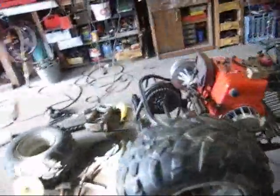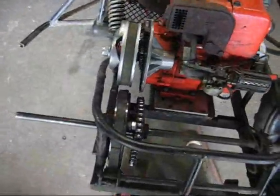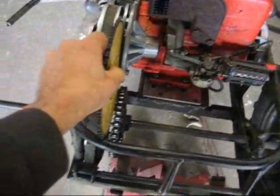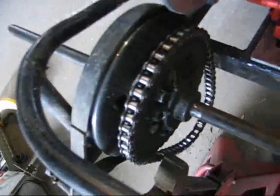So I'm working on this go-kart now, and I've figured out it needs a jack shaft, because I burnt up the belt on the torque converter — it kind of melted. It was about a 5.5-to-1 ratio, which was too big for these tires. They're like 21-inch tires. I had this sprocket in between here, between this little sprocket and the brake drum.